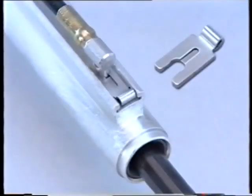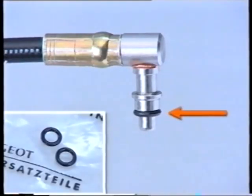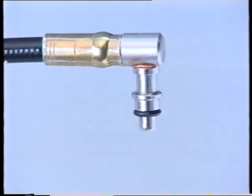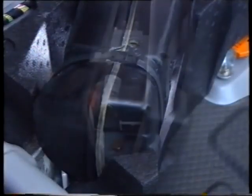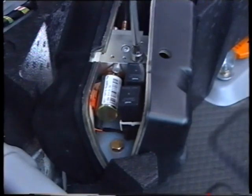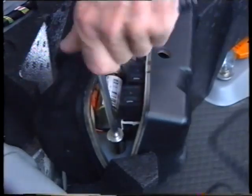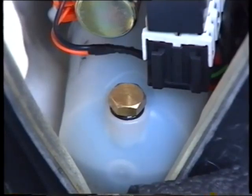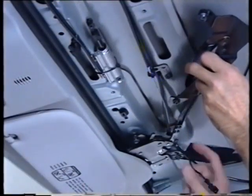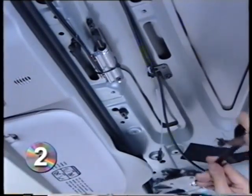The piping is secured to the actuators by means of brackets. An O-ring that is changed systematically ensures that the system is watertight. In order to remove the actuator for the roof locking mechanism, use a spanner to open the hydraulic circuit and loosen the hydraulic unit filler screw. Remove the locking mechanism and place protective covers on the vehicle.